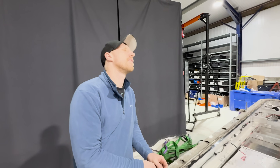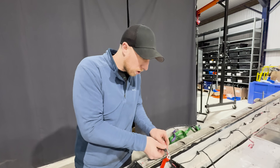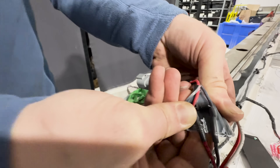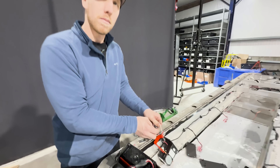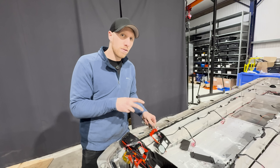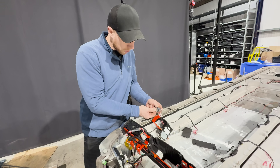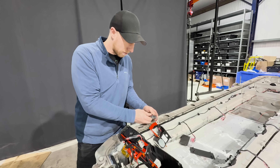When you don't have an economized contactor, what you can do is put a device across the positive and negative to basically make it economize — it recirculates the power, meaning it draws less power and doesn't heat up as much. You can actually buy contactors that are economized, which is what Felton use in every single one of their battery packs. If you don't want to run an economized contactor, you put this device normally in the main controller of the contactors.